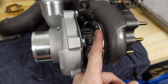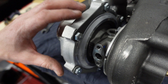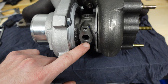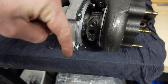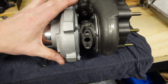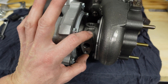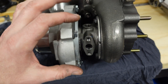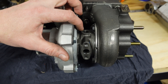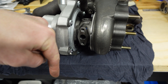We've loosened off the bolts for the turbine housing so that we can clock it — we can rotate it. Same goes with the compressor housing. One thing you want to make sure is that the oil drain is facing straight down, not cocked to the side. That's what Garrett say to do. Because once you loosen off both of these sides, the internal cartridge — the full centerpiece — can rotate quite freely. Also, you will have a bit of difficulty lining up your lines if you don't get it facing straight down.